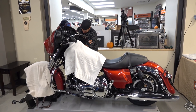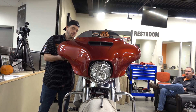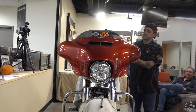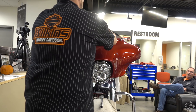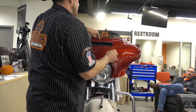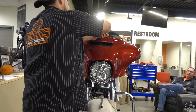We take the acorn nuts off first. When I take the fairings off, I always remove these two screws first, and it's really important on the Street Glides. When I take the windshield off, I take all three of the screws out, take the windshield off, then I put the center one back in, then I remove everything out so I don't have that chance of it falling off.